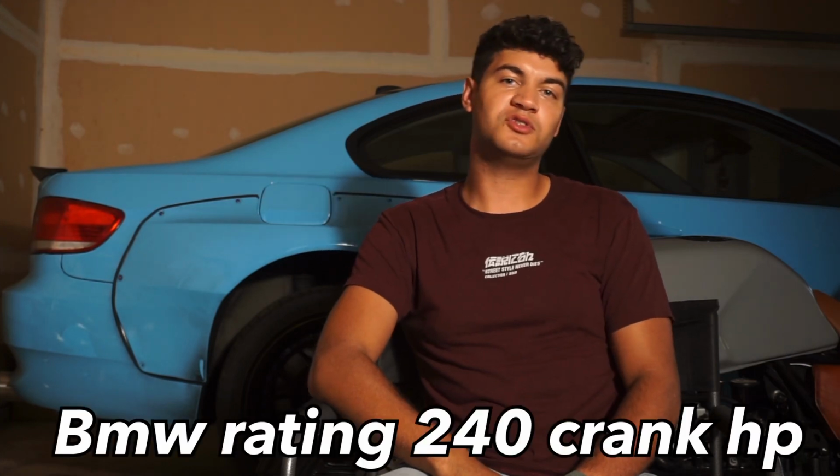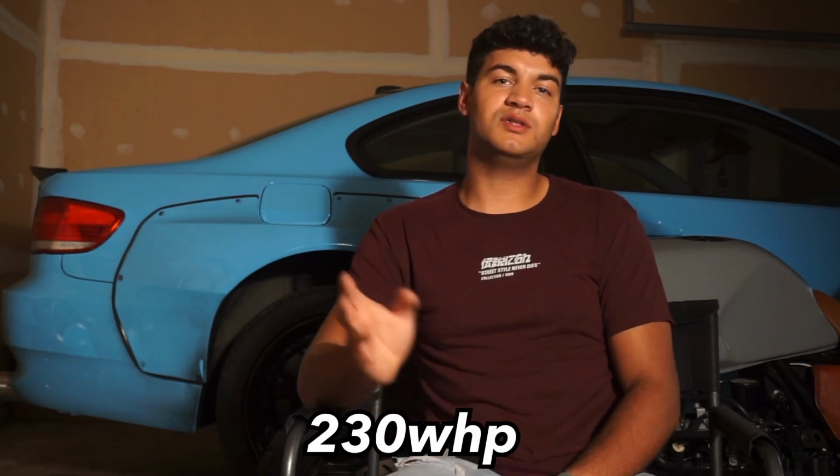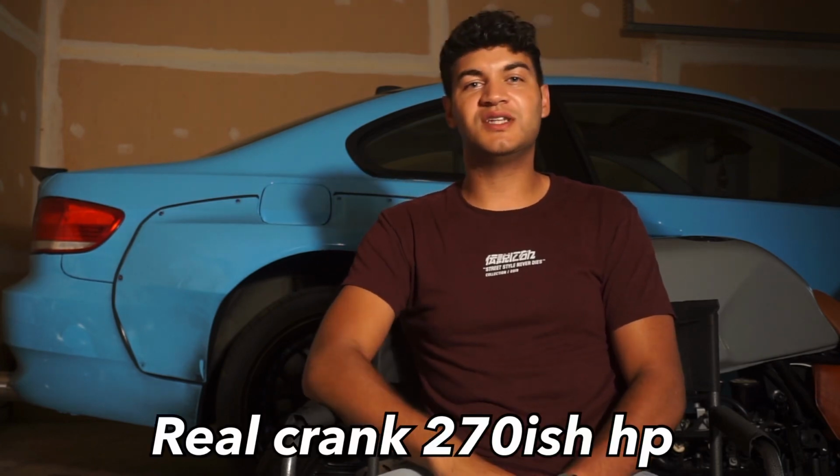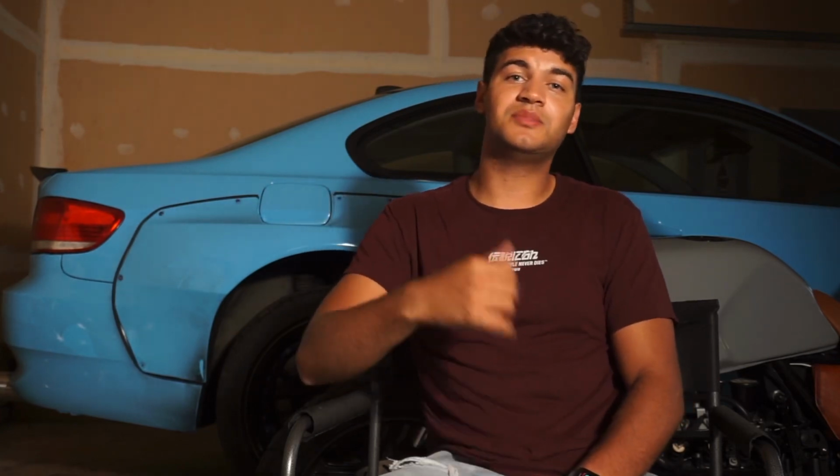BMW rates the N20 motor around 240 horsepower, and in reality, it makes around 230 to the wheels, which with a 15% drivetrain loss would send you around 270, and if it was like a Dodge or a Ford, they would give you an even 300 horses on this. Anyways, the reason why you're watching this video is because you're bored with that 230 horsepower, and also on the dyno it makes around 230 foot-pounds of torque. So let's get that up to 300.